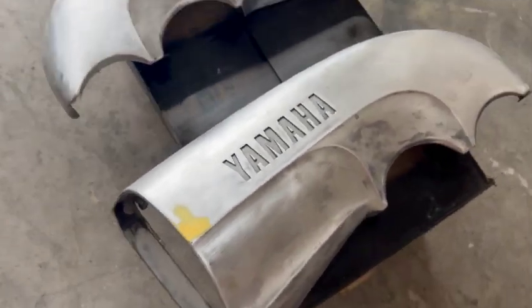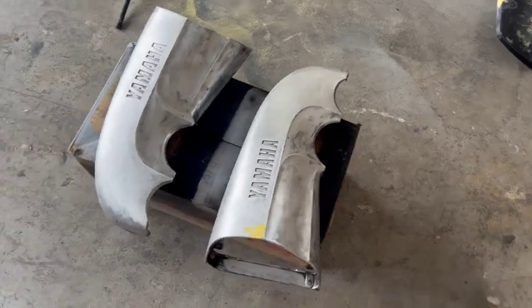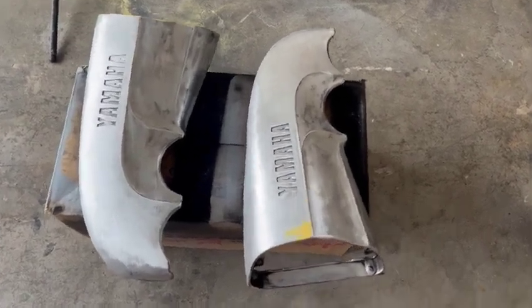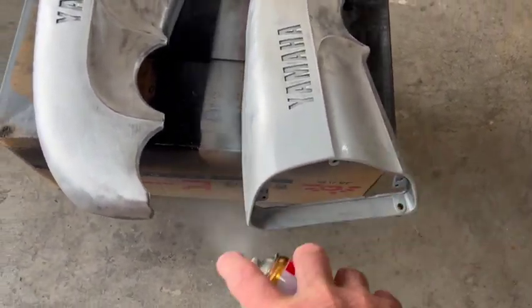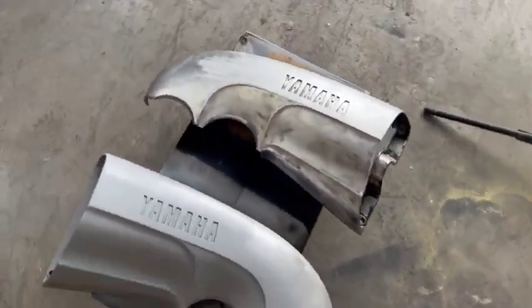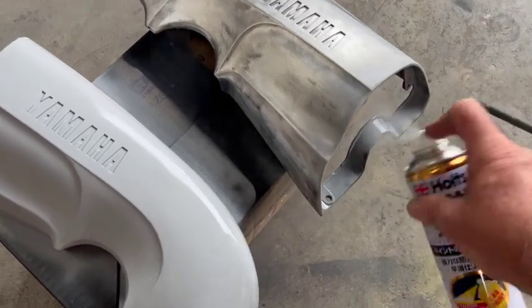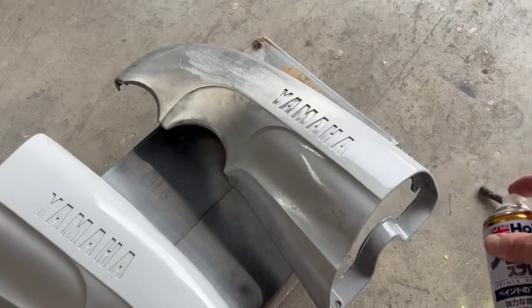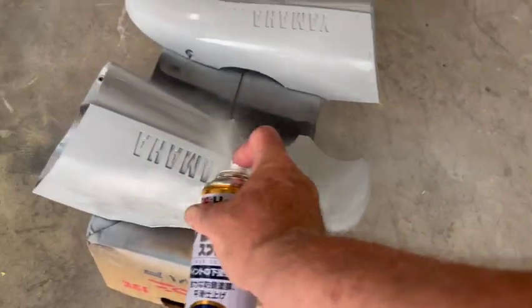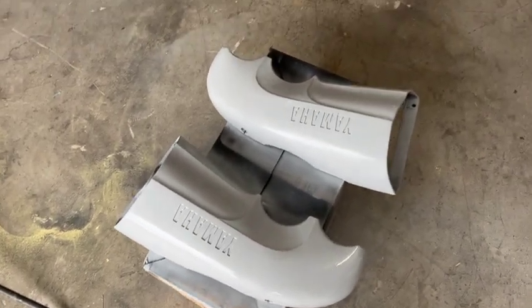everything. Now if you do repair, I always put 1 extra coat on where I'm going to repair, just to give us a little bit better covering there when we rub it down to rub the scratches out. So 1 coat on there, and then we'll start putting 3 coats over everything, and make sure you let them dry in between coats.